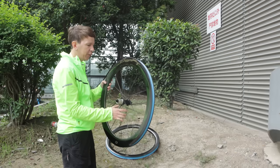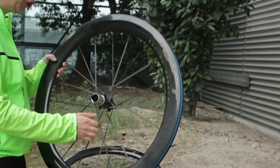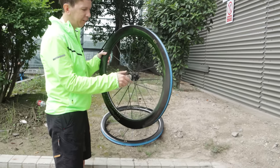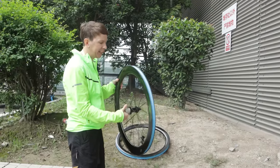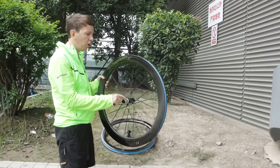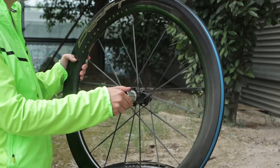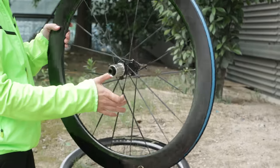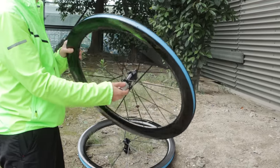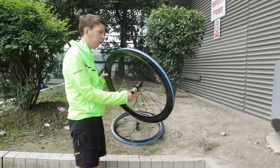The best things at the Shanghai Bike Show you find around the back of an alley. This is Craft Racing Wheels — these wheels are crazy light. The front wheel is 50mm deep, the rear is 60mm deep, and together just 1,280 grams. They're laced with carbon spokes to their own hubs with what feels like a DT Swiss ratchet system. There's also a narrower 45/50 version at around 1,230 grams. Choice of Shimano or XDR freehub. I've been riding these on my gravel bike for a couple of weeks — they get up to speed super fast. Also in stock now on pandapodium.cc.